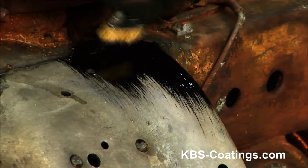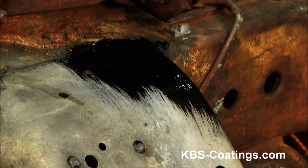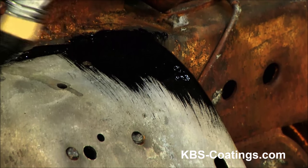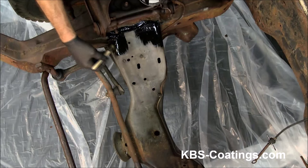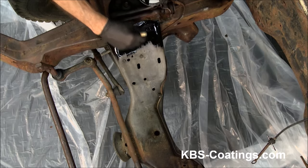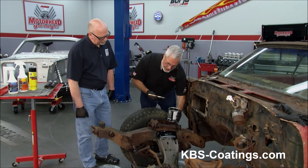What's interesting is you put this stuff on with a brush and it flows out — it looks like porcelain. So this is cured with humidity? Yeah, it's a moisture-cured urethane product. The more humid it is, the faster it dries on you. If you're on a real humid day, you're going to have to work a little quicker. And of course, you want to keep the dust down, keep the bugs out of it. But this is now a nice, clean, etched surface.